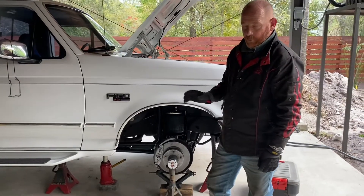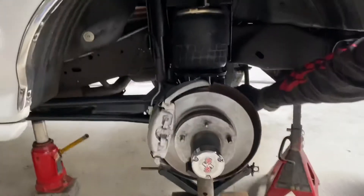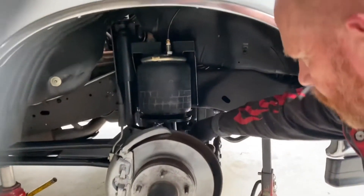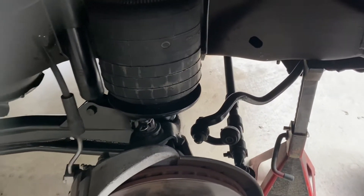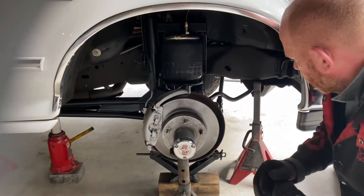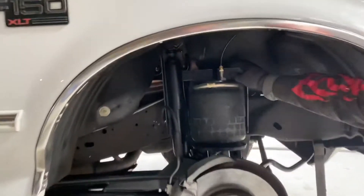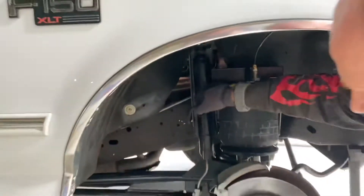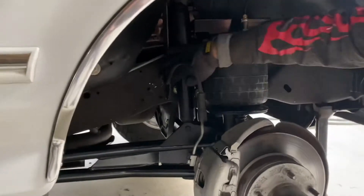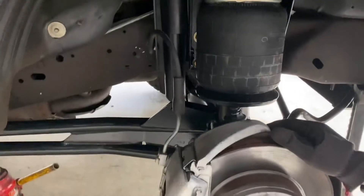When I connected it there was a bind, and I really didn't want to leave that, so I'll reuse them for something else. I'll show you the new brackets in a minute - this side is finished now. The only thing I haven't done is reconnect the sway bar; I figure I can switch the link the opposite way and weld in some tabs at the bottom to reconnect it, but I'll do that in a few weeks. The bracket itself fitted fine with five bolts fastening it to the chassis, and the shock mount worked fine with two bolts. The brake hose is bolted to the side as well.